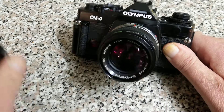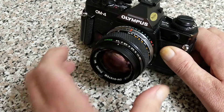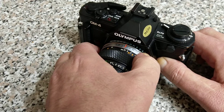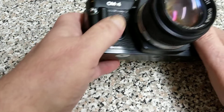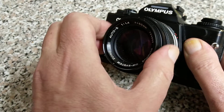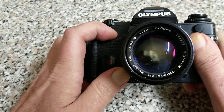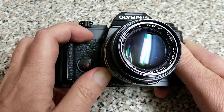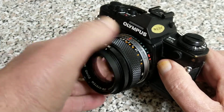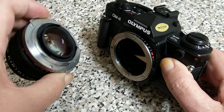There's a little lens cap on this one. What lens have we got on here? We've got a 50mm f/1.4 — I do like this lens. To remove the lens, there's a top little button here. The one at the bottom is your stop-down lever or depth-of-field preview — push the bottom button and you can see the iris close up. The top one is your release; turn it anti-clockwise about a quarter turn and the lens will come off.